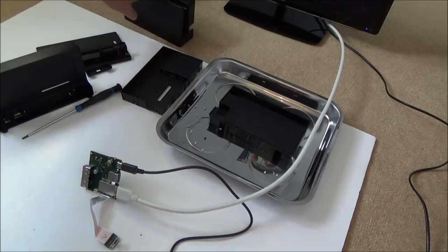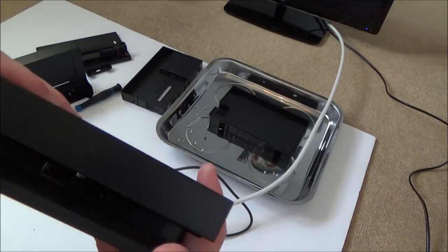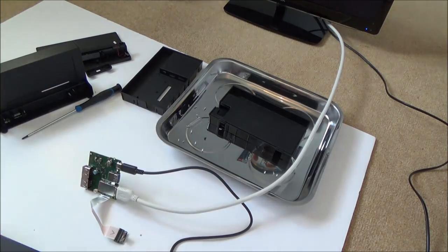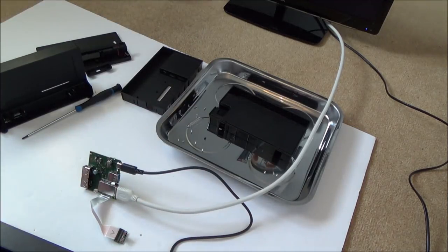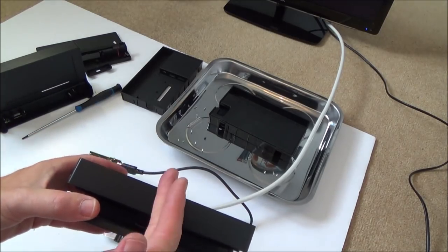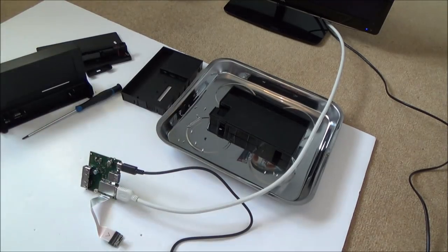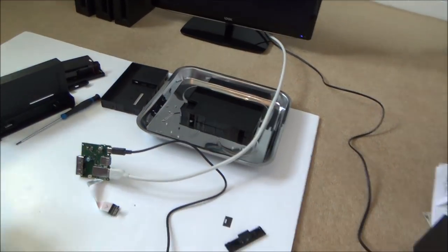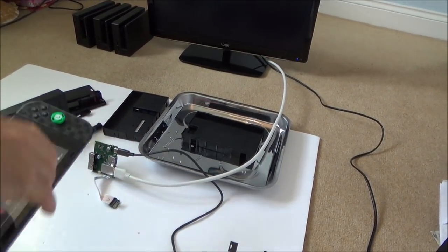Let me work this out a second, because although USB-C is reversible, I don't know whether the Nintendo Switch is reversible or not, because remember we have this section here. We've got that big lump there at the back, and that lump goes into this part here, so you can't put the Switch in backwards, you can only put it in forwards. So that says to me, I took it out that way, so the ribbon cable is going to have to go towards the back, isn't it? If I put that big lump, so the missing section on there, I should be okay. Right, okay, let's see what happens now. Let's see if I can get this in shot okay. There you go, you can get a bit of the TV there. Put this back. So I'm going to plug it in like so.